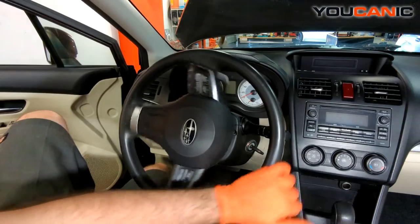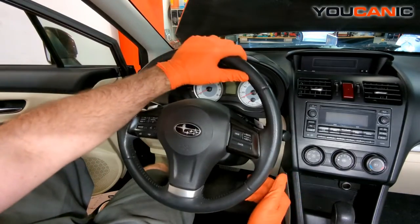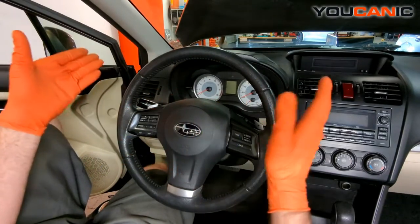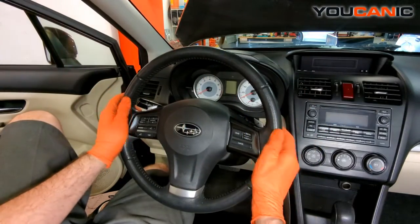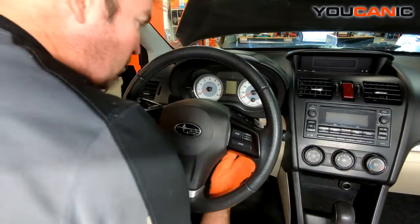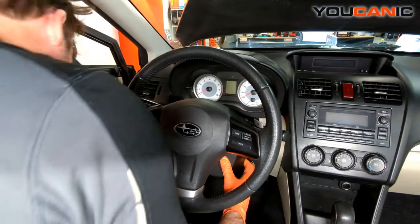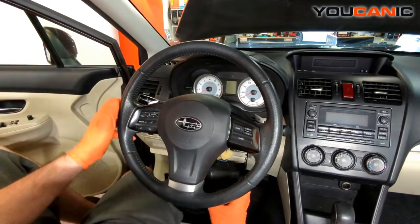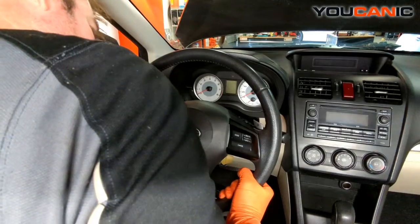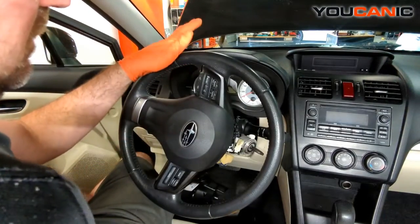Turn the steering wheel to the side and you'll see there is a screw there. Do the same thing the other way and there's a screw on that side. Keep the orientation of your steering wheel in the middle — look at where your tires are and make sure they are straight forward. Then pull the two pieces apart: the top comes off, and for the bottom you may need to release the lever that makes your steering wheel go in and out and up and down. Put the steering wheel all the way down, pull towards you, and spin it basically 90 degrees.